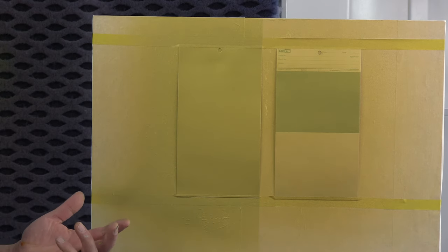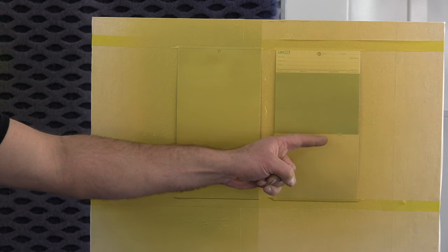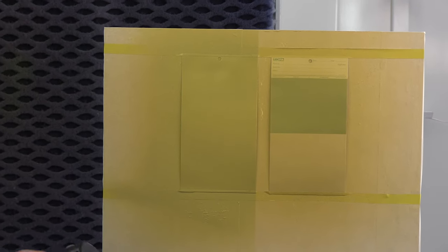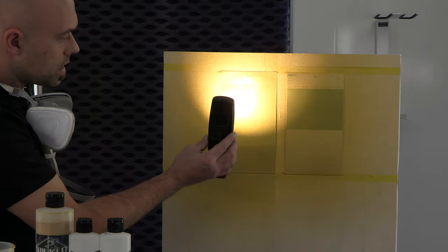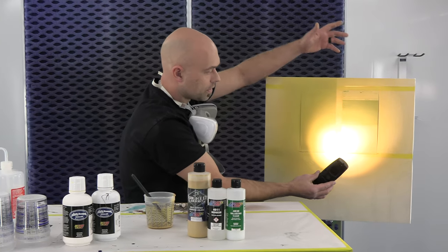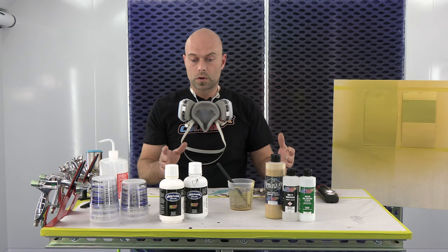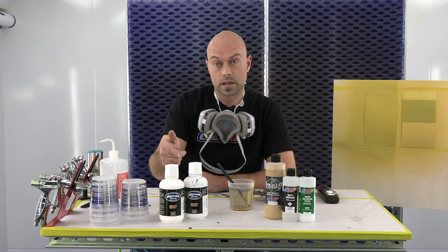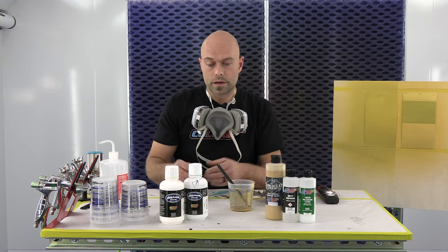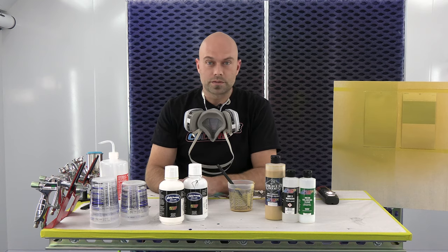Okay everyone, we're back in the booth. Both panels are dry — it's been about 10 minutes. We got two coats and a control coat over both panels, and there's a massive difference visually between the panel without a ground coat and the one with it. The gold is nice, even, and consistent on the sealed panel; on the unsealed one you can still see through it and even read the letters on the card. That's going to translate into achieving nice even coverage without having to put a lot of material on. To recap: we use sealer tan and sealer yellow to create the ground coat for the gold — it works for metallic gold, pearl gold, or any gold color in our line. Simple way to keep everything consistent and achieve a perfect finish. Hopefully this helps — thanks for checking out Base Coat Basics and we'll see you next time.